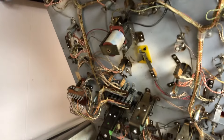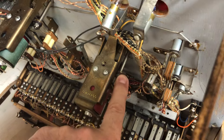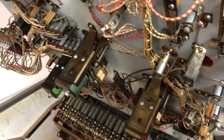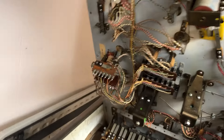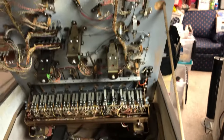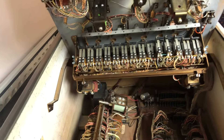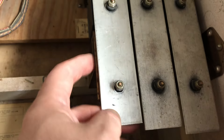I have to go through and ohm test all the coils to make sure they are good. Nothing breaks — a lot of times when you take off the pop bumpers and unscrew these, you can break the shaft. It's normal, it happens. I should be able to burn through this really quick as long as life doesn't happen. I also gotta get a chime box rebuild kit because this is clearly jacked up.